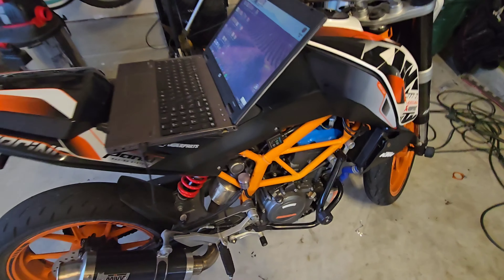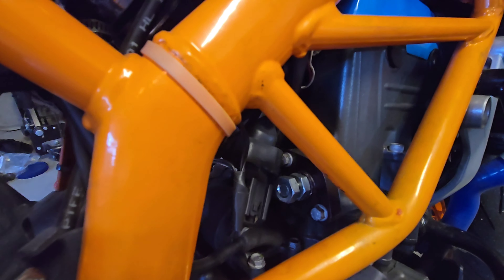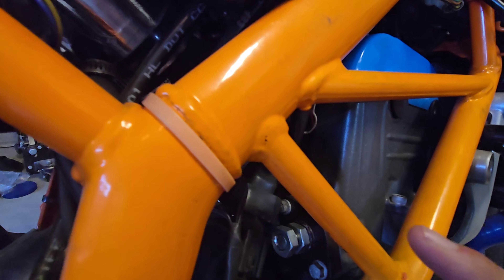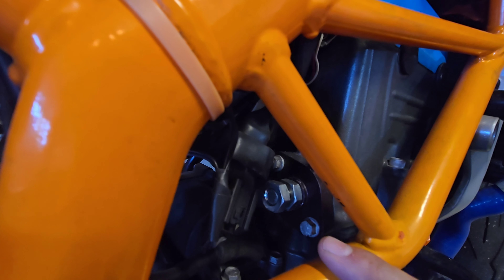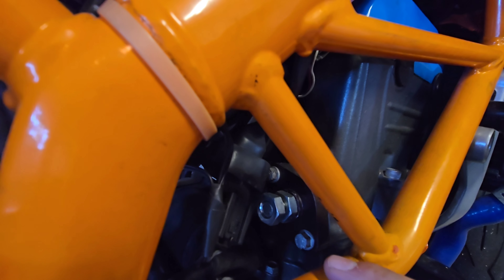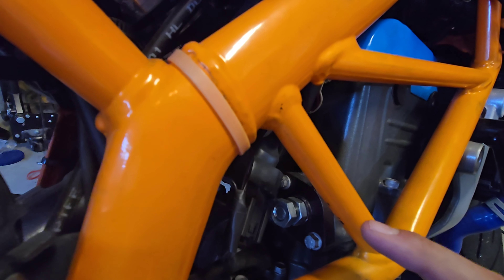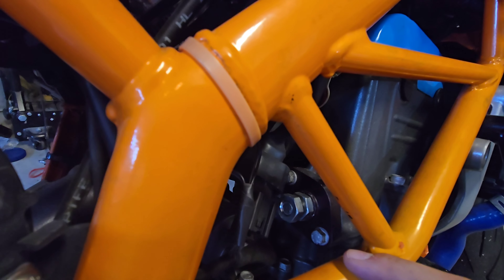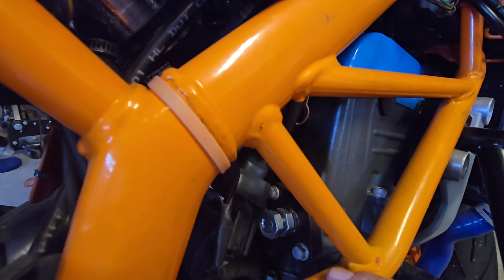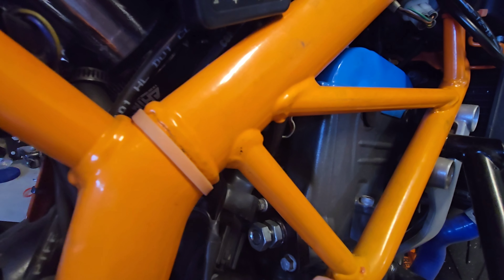So in my particular case, as I was working on this thing, I went ahead and looked at my manual timing chain. I wanted to go ahead and just take a look at it — it's been a while — and make some adjustments. When I made these adjustments, it was enough to cause it to run a lot leaner. I'll show you here in a little bit. I'll go ahead and start it up, rev it a little, and you can see on my air-fuel ratio gauge it struggling and going lean, as well as the bike stumbling on its face because it just doesn't have enough fuel to properly rev smoothly, at least when you crack open the throttle real hard.